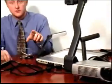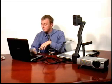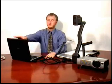If no image appears on the projector, make sure you're toggling your laptop to send a signal out of this connector. On some computers it's Function + F8; on this computer it's Function + F10. And that's all — you should be able to see whatever's on this laptop out of the projector connected to the QD700.